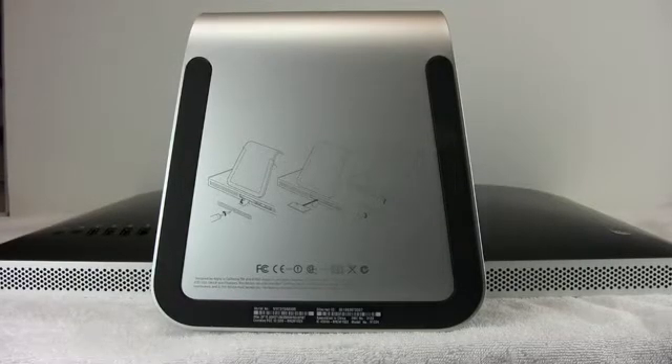I'm going to demonstrate how you install memory into a new mid-2007 Apple Intel iMac. The procedure is the same for the 20 or the 24 inch machine. First you need to clear a space — I'd suggest a kitchen table or a dining room table — and place a bath towel on the table to protect the face of the iMac. Take the iMac and place it flat face down on that towel.